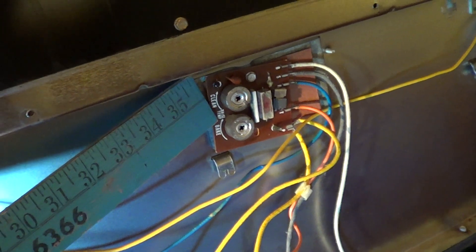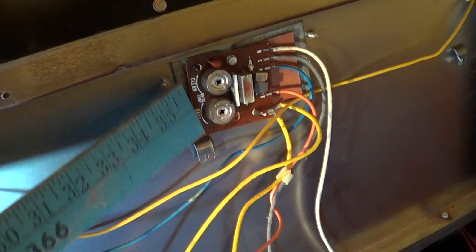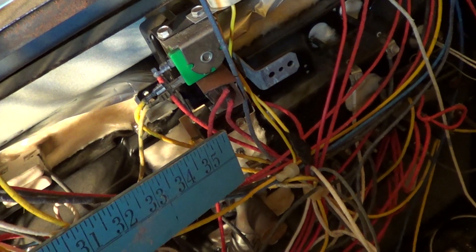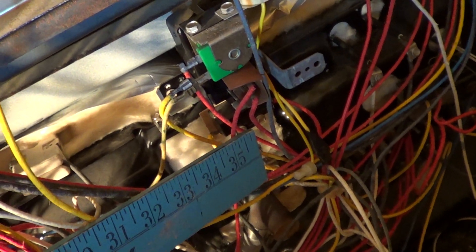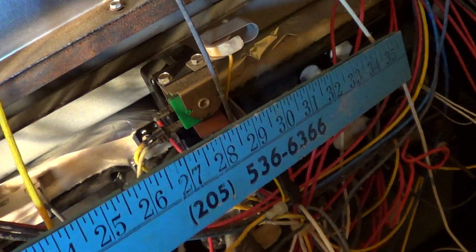In clean mode they short out the resistor in the front, and basically it's going to go up to around 850 degrees. There are a lot of interlocks down here. There's a relay that's used to lock out the door, and there's also a solenoid and another two switches. You could never open this thing up with the microwave oven running. There are about three or four interlocks, plus another one hidden inside back with the door — really very conservatively designed as far as not getting hurt.